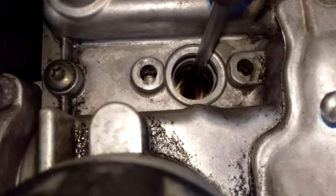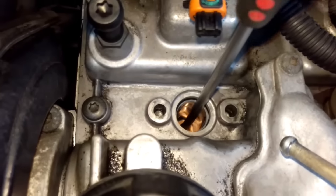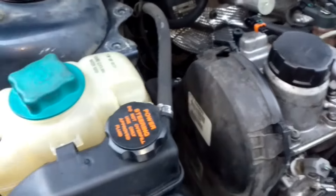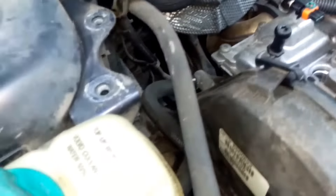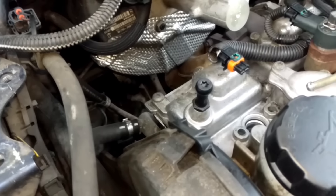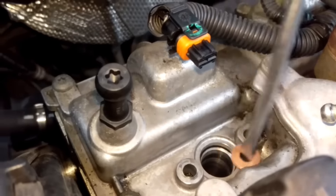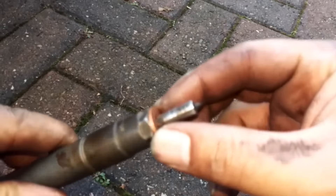As you push down into the copper washer the wedge shape grips. Just put it in now — there's the washer down at the bottom. Just push the screwdriver in far enough and there we go, it's caught on the wedge and the copper washer comes out no problem at all. And if the washer is really badly carbonised and stuck in there, it's still going to be no competition for a good spray of carb cleaner. Just spray that down the sides of the injector port — you don't want it going into the engine — then put the screwdriver in again, give it a wiggle and it'll come out exactly the same.